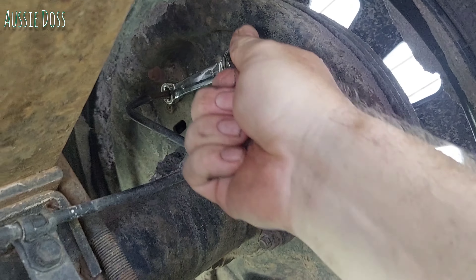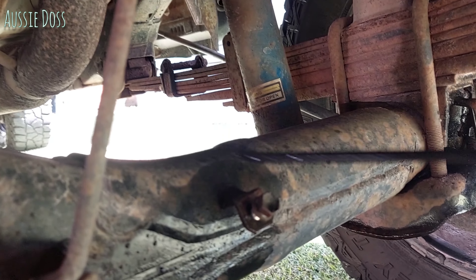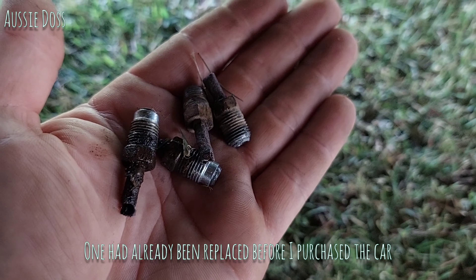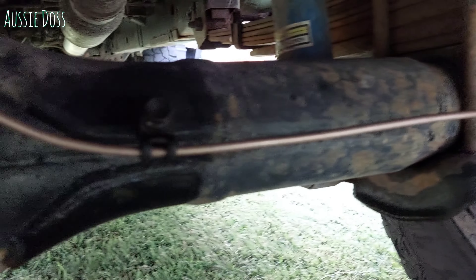Let's do it. Alrighty, so we got three of the brake lines pulled off in the end and four of the fittings snapped off doing that. So we're going to go and get some new brake lines — this is what they look like. You just want to bend them up to match the old brake lines as close as you can before you put them in.